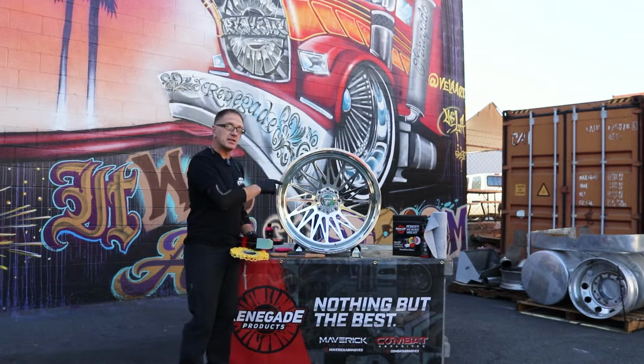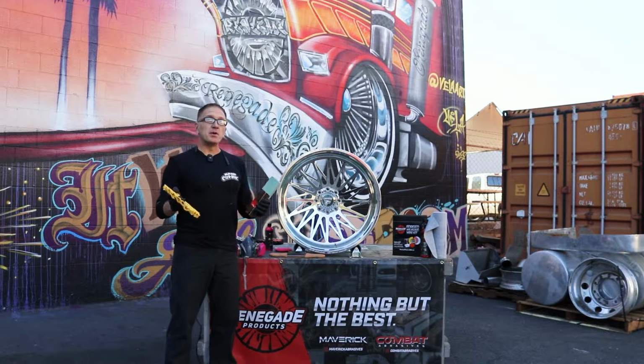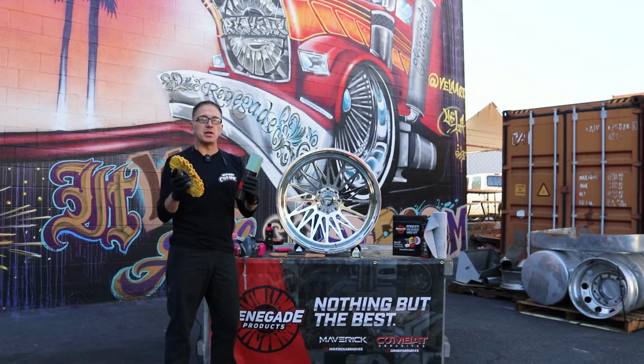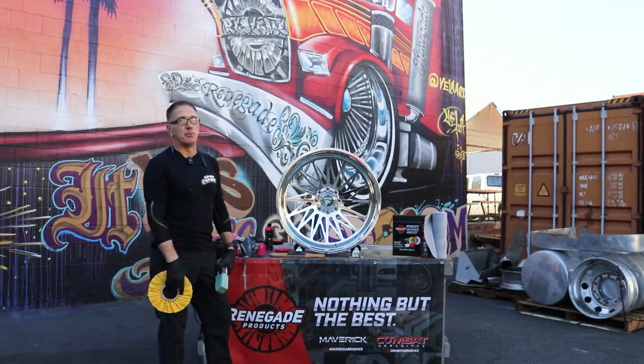After that, we're going to wipe it down with a dissolver, and I'm going to apply the forged red hand polish, and then we're going to buff that off at a low RPM. I'm going to be running both the triple E cut and my mid stage at 3,500 RPM. Once I go to the final stage, I'm going to slow it down to about 1,400 RPM for my UBM and my purple bar.